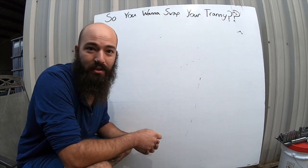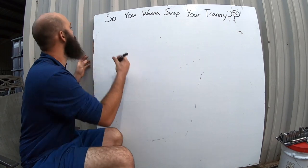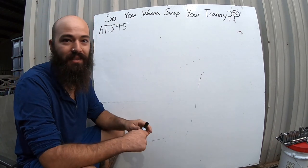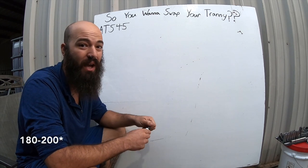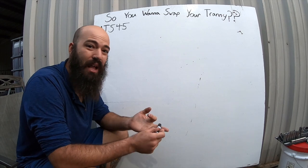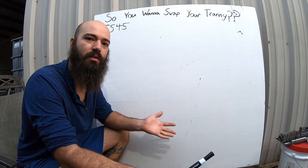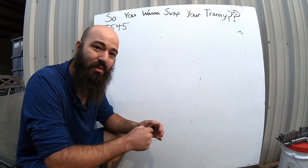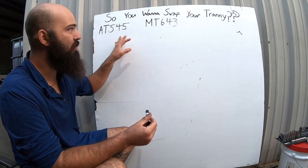The first transmission — the one that we have, the one that is doomed — is the AT545. This transmission is very widely used in school buses. It is a low-powered transmission; it only takes about 200 horsepower, maybe 230 horsepower max. People don't like it because it overheats easily, it's only got four gears, there's no lock-up torque converter, and the gears are really made for stop and go — they're made for the city, made for a school bus. It's not great for the highway or the mountains; we've been seeing about 2300–2400 RPMs at 55–56 miles an hour, which is terrible.